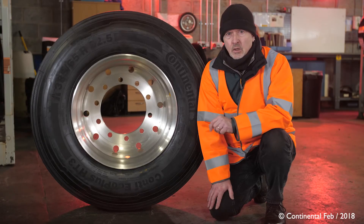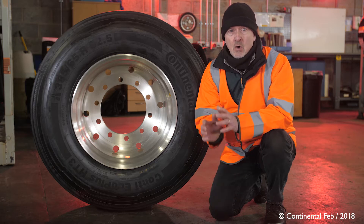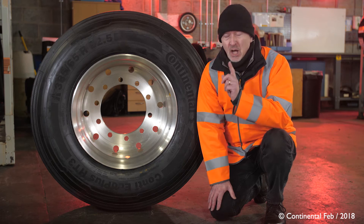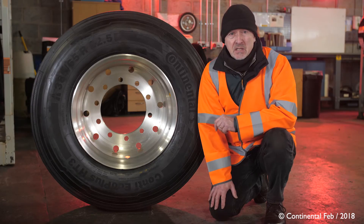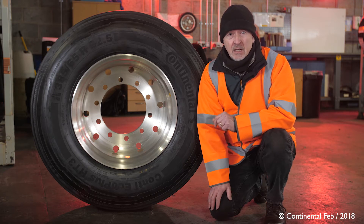During the course of your work you'll come across some vehicles with CPC sensors and the rubber containers already fitted to the tyre. Before you start removing the tyre from the wheel, you need to remember to do this away from the dot code on the sidewall of the tyre. This is because the CPC sensor is normally aligned with the dot code and the valve in the inner tyre, and we don't want to damage it when we take the tyre off.